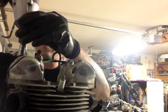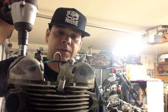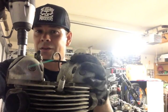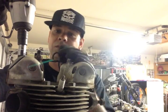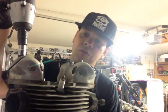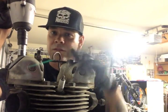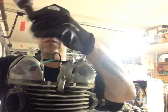You could spray penetrant if you think something's really rusty — like if the bike's been sitting outside for 20 years, a barn find or something. This bike was outside for a bit, but not long enough that I feel I need to heat anything up or use nut-busting WD and let it sit overnight. You can snap studs and then you're into a whole different mess — drilling and tapping out broken threaded studs from the head.